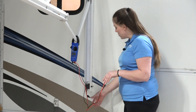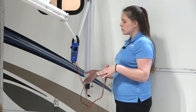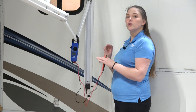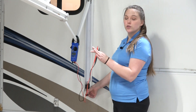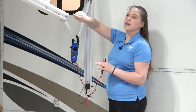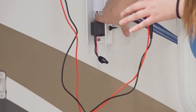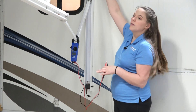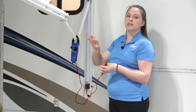After you've checked your charger, come to the charging port at the bottom of your awning arm and check that for good voltage as well. This charging port is connected to the battery through the arm assembly. You'll have two wires — one for the charging port to the battery, which travels up the mount arm, down the inner arm, and up the outer arm to where the battery is housed. Your other power line goes to the motor, running through the switch, up the arm, down the inner arm again, and all the way up the outer arm to the motor at the head assembly.